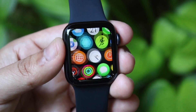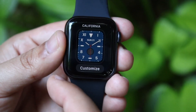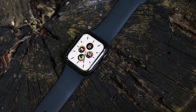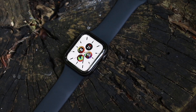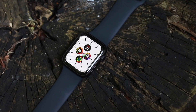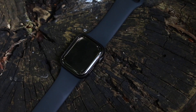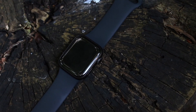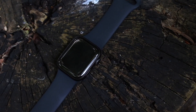What I'd recommend is first going onto your iPhone and checking if airplane mode is on or off. Then double-check that your watch is updated to a more recent version. There have been several versions of iOS that caused a lot of disconnecting issues for Apple Watches — I've seen this even recently with iOS 14, where a 14.0.1 update caused Apple Watches to disconnect repeatedly.